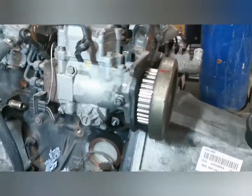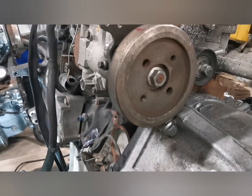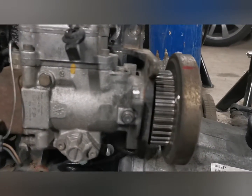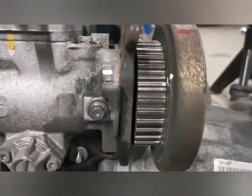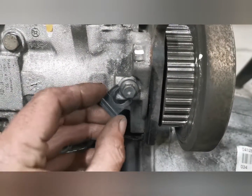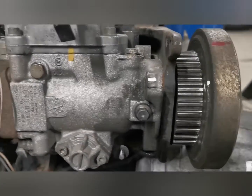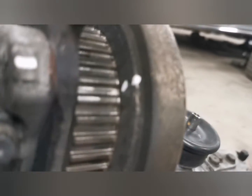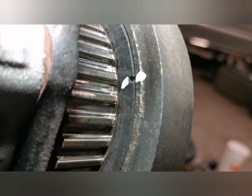You'll be inside the van when you come to do the pump side, looking at it from this side — the body comes here so it's a bit of a pain. The fuel pump lock is here — it's a 10mm bolt. Basically what you'll see when you look at yours is this, and as soon as you crack that off it's just going to drop, so be ready to see where it goes because you'll need to put it back. In the pulley there's a little notch — I've put Tip-X on it just to highlight it.